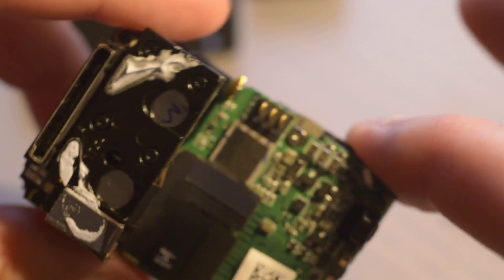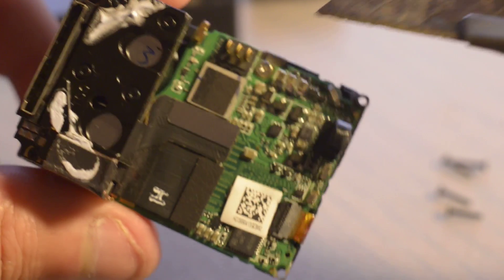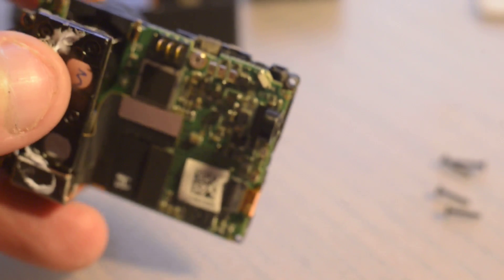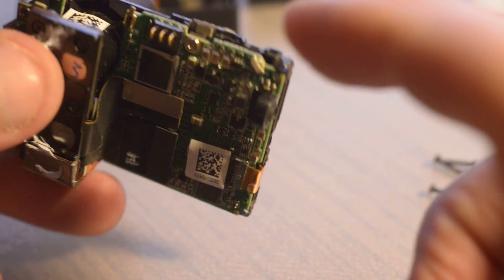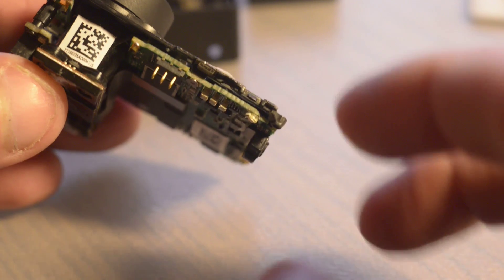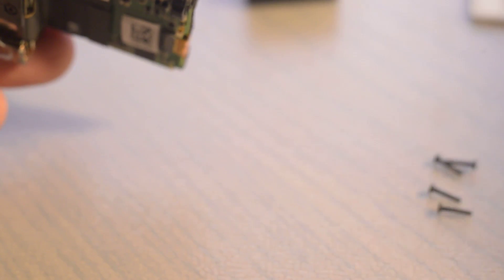You've got the battery contacts there. Looking at the actual fault — you've got these three contacts here: one, two, three. What I did was gently pry them up. When I looked at them, they were all at different heights. They're basically spring contacts which make contact on the board when you press the shutter button. Over time, maybe due to temperature variation or whatever, they don't make very good contact. So just pry those three up a little bit.